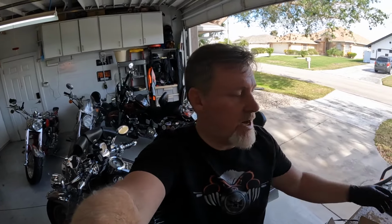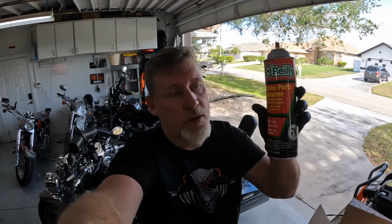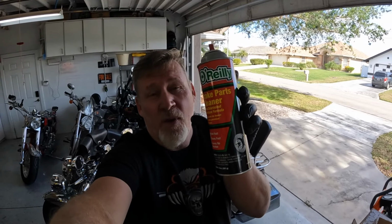Yeah, the other question you might have is, how do I clean up any mess that I've made? So I always use brake clean. It cleans about everything. It dries really fast, doesn't leave any kind of residue. It is great stuff. It's how I clean out my oil pans and all when I'm done. I'm pretty particular about my shop, so that is what I use.